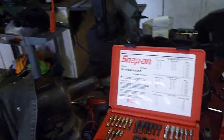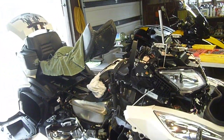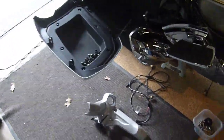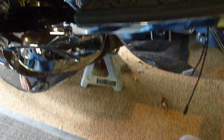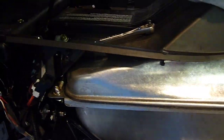If you're thinking about doing a chrome handlebar 'cover' — it's not a cover, it's a handlebar, that's what you're replacing. One of the main hard things is you also have to get this wiring harness out. This all goes to right here — this is your power connection, and this is your audio connection.